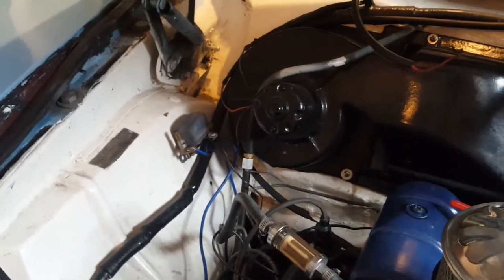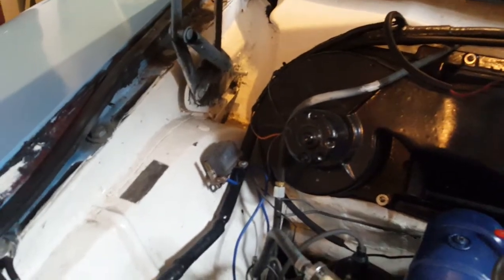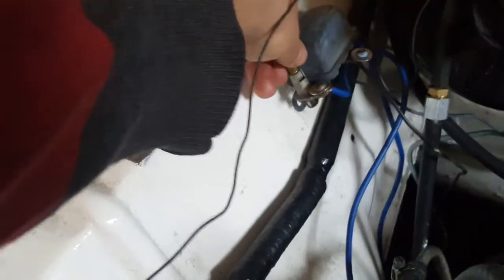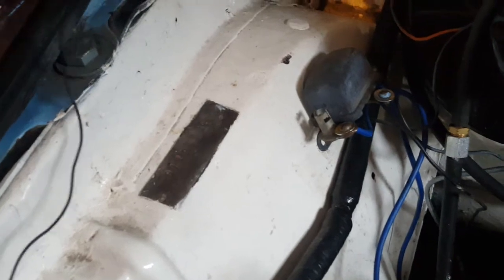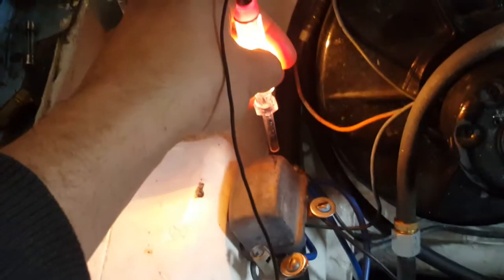I know the overdrive was still engaging because I was still able to go at 110 kilometers an hour. That wouldn't be possible if the overdrive wasn't on. So, again, that's my problem there. That should be completely isolated. Let me take the fuse off and see if it still turns on, because that would then really confirm the tests. As you can see, it's still on. So we have negative, or we have ground from the governor, and we shouldn't have that.